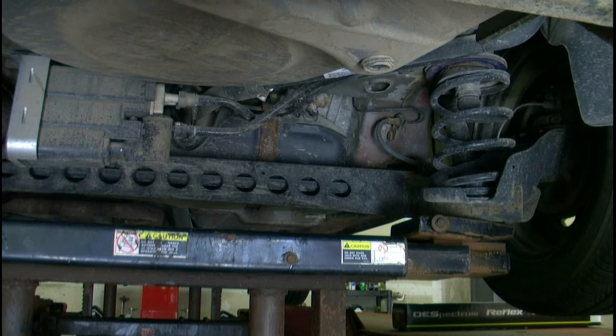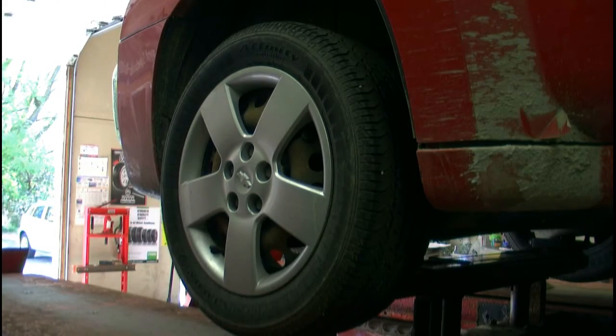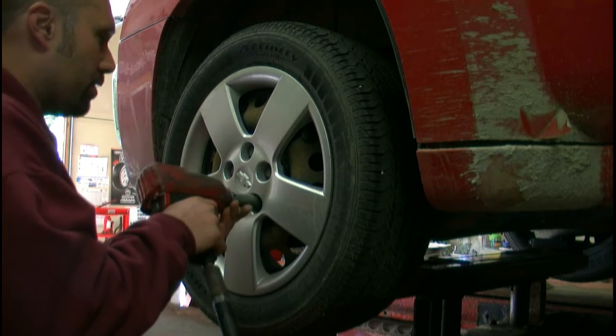Right now I have it lifted under the rear axle area to start removing the shocks. I'll go along and take off one wheel at a time. I'm going to start with a 19mm socket — I like to just use a deep well — and I have my half-inch impact drive.